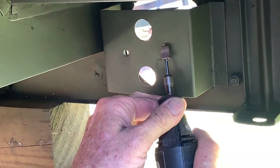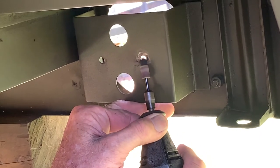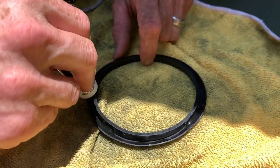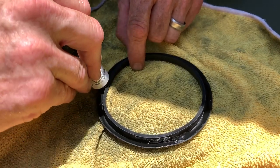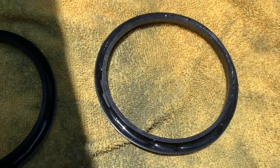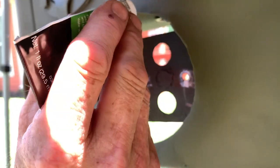After I got done with both holes on the back side of the bracket, I moved to the inside of the tub and did the same thing on the mounting holes on the inside. The inside of the bracket is a tight little spot so be careful there when you're using the dremel tool — as you see we slipped a little bit ourselves. On the underneath side of the tub I'm just going to remove a quarter inch of all the paint and primer and get down to bare metal. This is where the lock washer is going to bite into the back side of the bracket, and then we can put the nut — it's going to make for a nice ground point and contact. We'll wipe up all the dust and residue from grinding off the paint and work on part number A627, a pair of rubber grommets that go around the sheet metal that actually surround your tail lights.